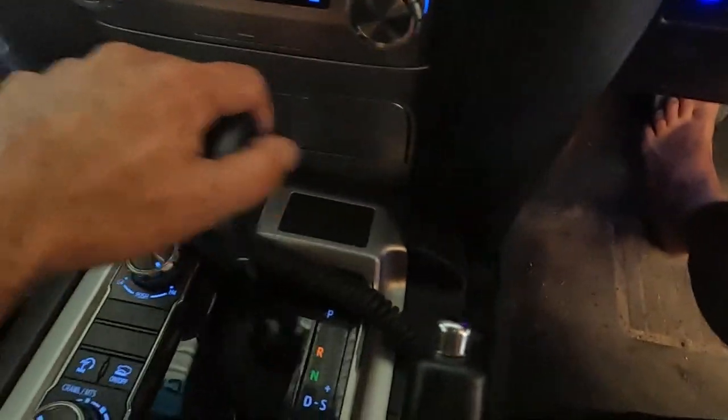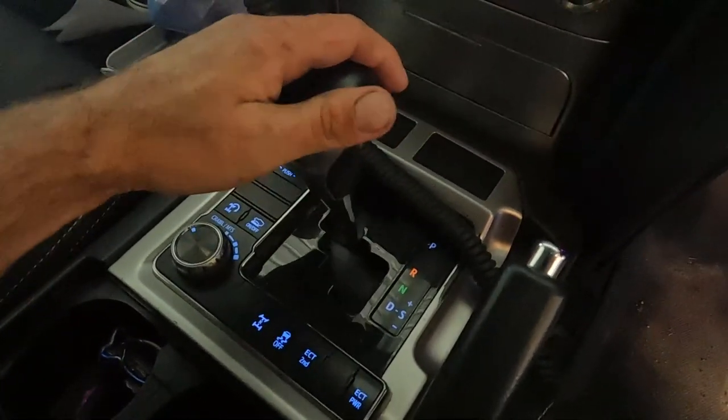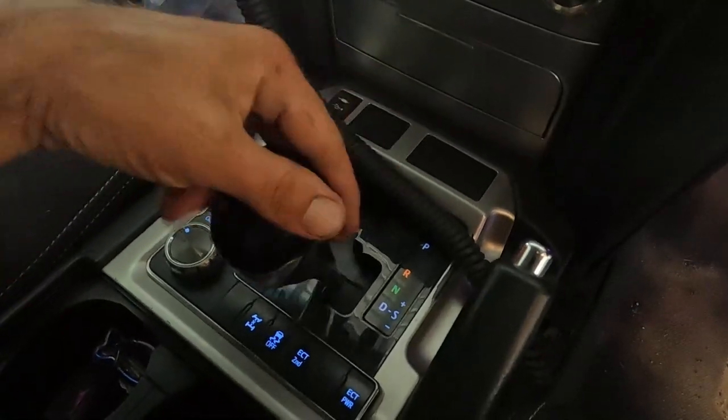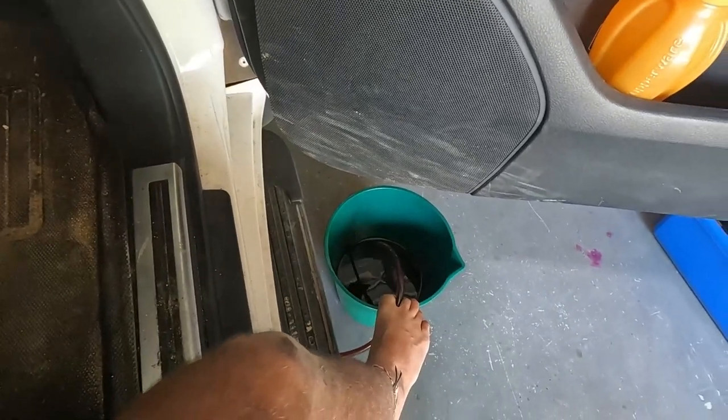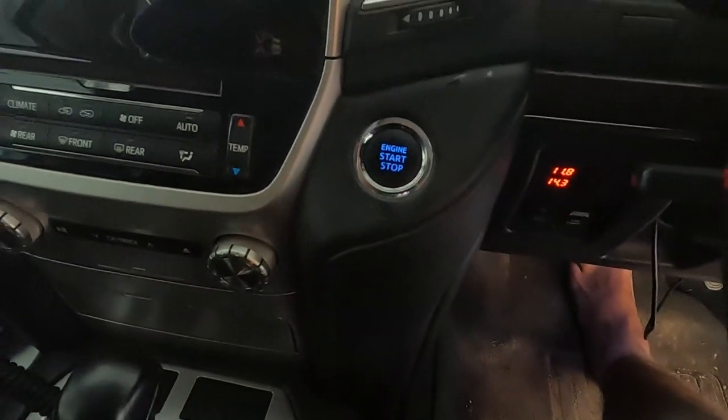I'm just going to go through the gears a few times until we get to our two liter mark. That last pump I've done two liters out and I'm not going to refill it because now I'm going to drain the pan and take it off to do the service. We're down two liters, so I'll measure whatever comes out of the pan and add those together to know how much to put back in.